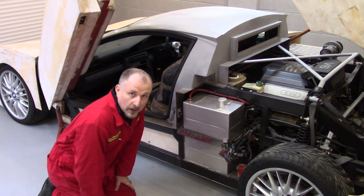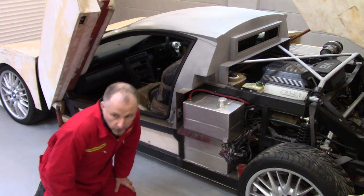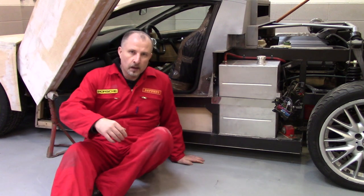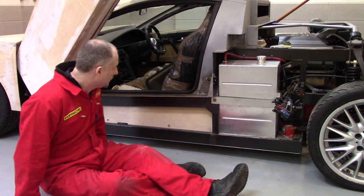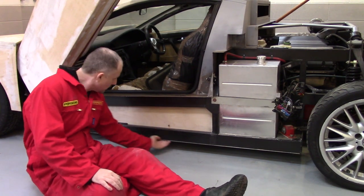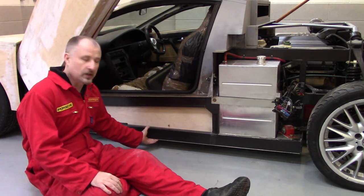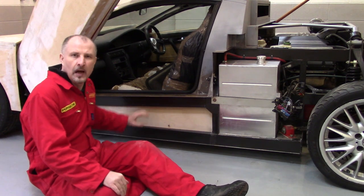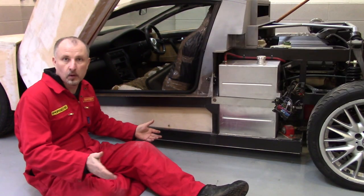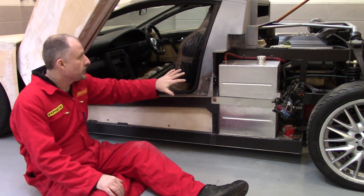That's not easy with just one person, so I hope you appreciate what I'm doing just to show you under the skin. So there we go, the side's off. You can see the chassis rails - one there, one there. And there's the aluminium floor - this is pop-riveted and also glued and sealed, so that really shouldn't rust. This also shows the modular design that I'm going for. All these body panels are separate, so the side can come off and you can put on a different one - different design, different styling. This is a lot more work to do than just a one-piece body.